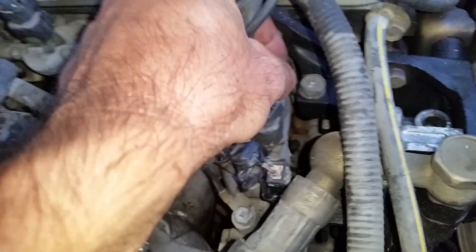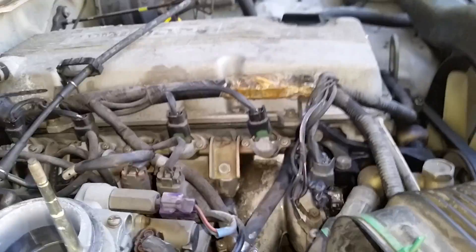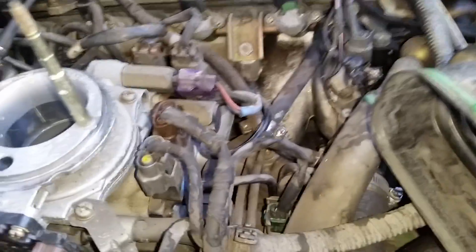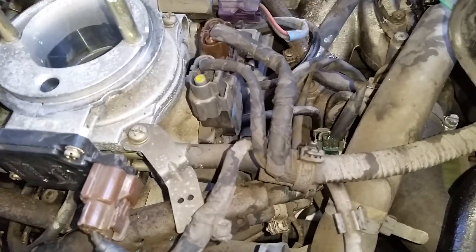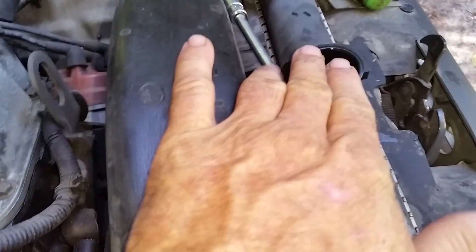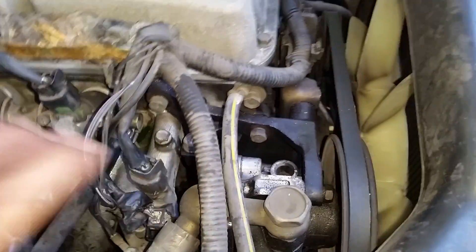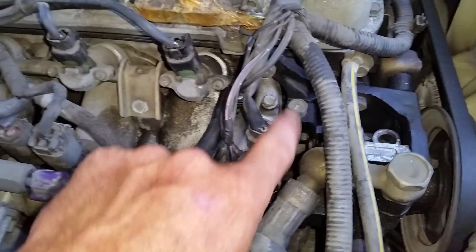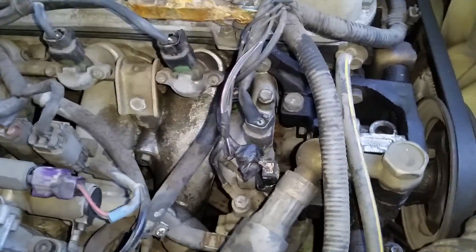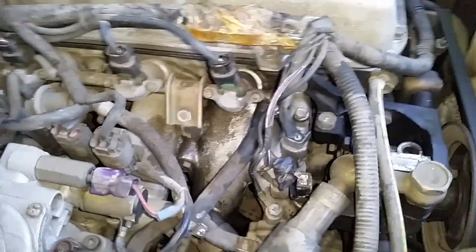That really affects how it runs, and that's just a little tidbit of information when you're trying to diagnose an idle problem on these Nissans. It applies to pretty much any Nissan with a 2.4 liter engine like this one — most of them with a throttle body that have coolant lines running through it. The fill point is higher than the bleeder valve, so as you fill it the coolant level rises and pushes all the air out of that valve. Do that and you'll know that air in the cooling system is not the cause of your idle problem. Thanks for watching.